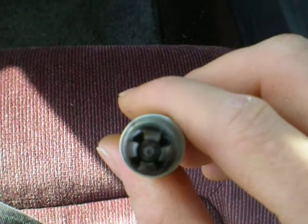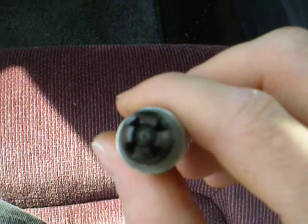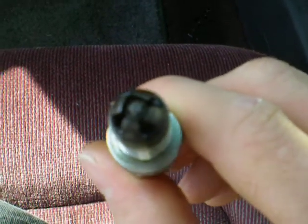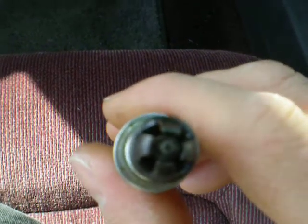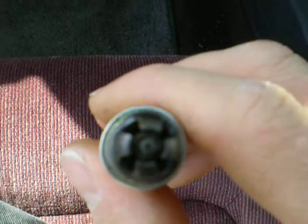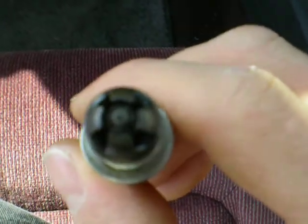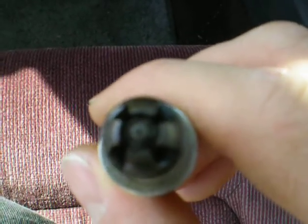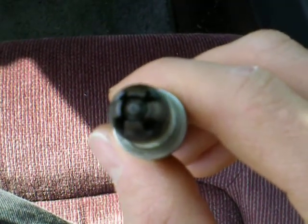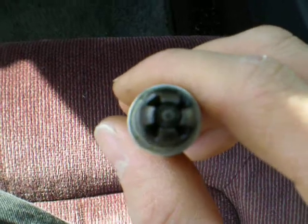I don't know if you can see it, but it's burning a little — burning pretty good, except every time I pull it out I usually get oil on the tip of it for some odd reason. I think it's an oil seal that's going out, but that's not the big thing. It runs perfect, it doesn't use any oil. It's on the 93 Honda Accord, so the hole where the spark plug goes through has an oil seal there that leaks.